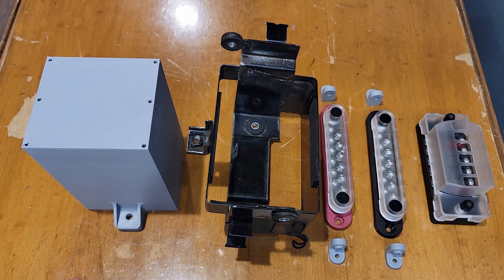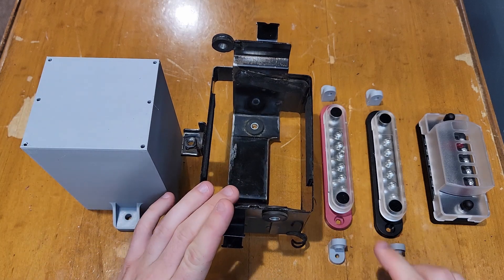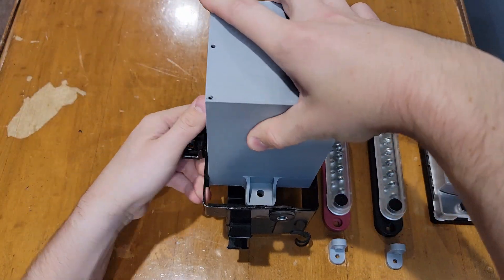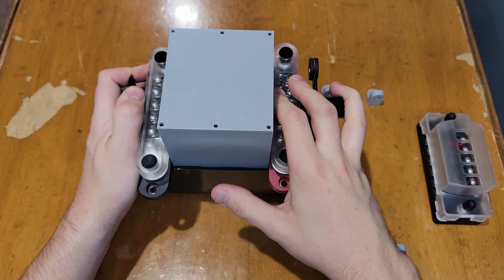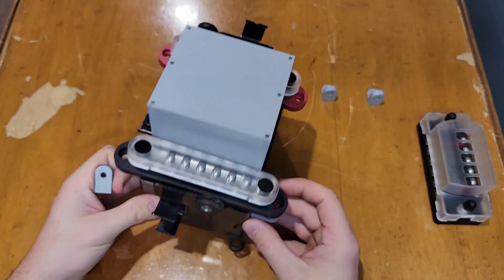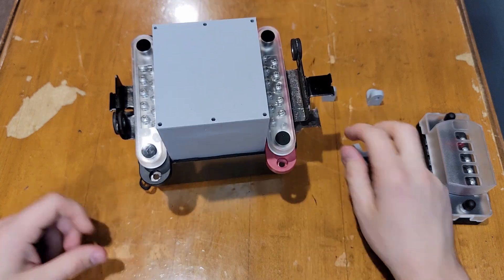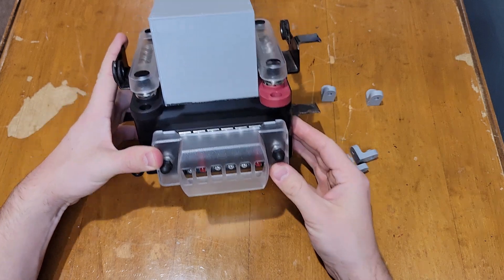Here is the entire setup of the 12-volt system. I have the battery box, the battery box compartment that the battery box will be sitting into, the positive and negative distribution terminals, and the fuse box. This battery box will sit in with a positive here and a negative here on both sides. I designed some right-angle brackets that'll sit underneath, and the fuse box is going to sit on drilled and tapped holes at the bottom.